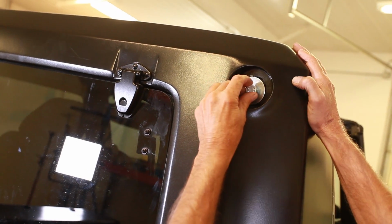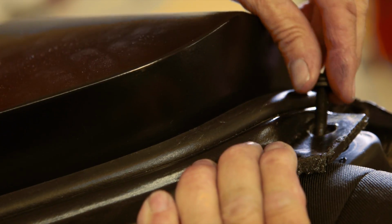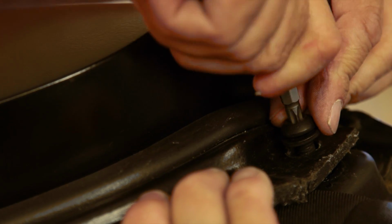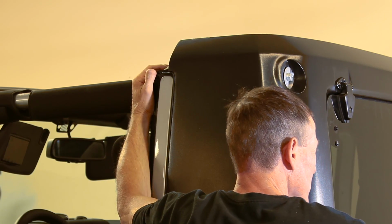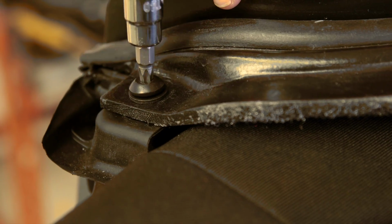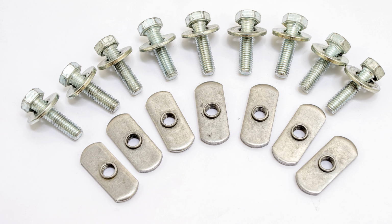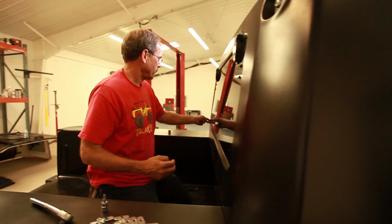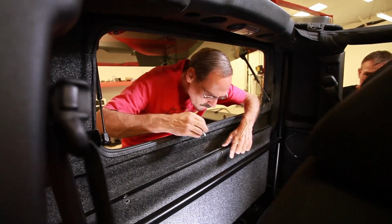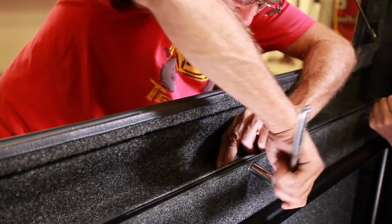Start a sport bar bolt to help with proper alignment of the top. Also start the top bolts that are usually located under the freedom tops. Now when installing the bolts, start with the center bolt, then just move to any bolt that can be easily installed. Order really isn't important. Tightening is required to help with bolt alignment, but do not final tighten.